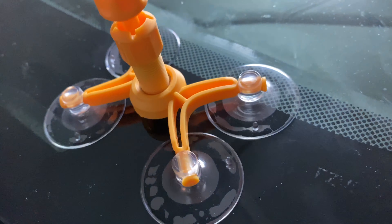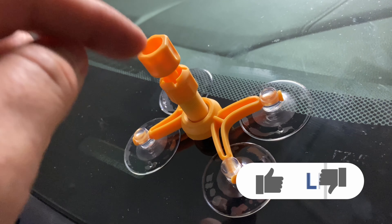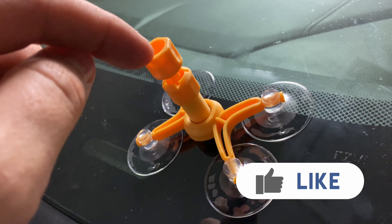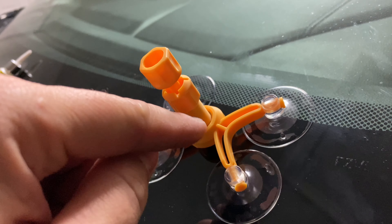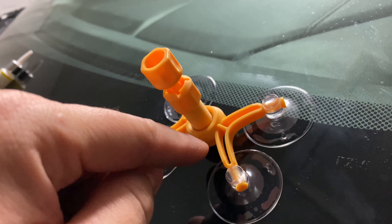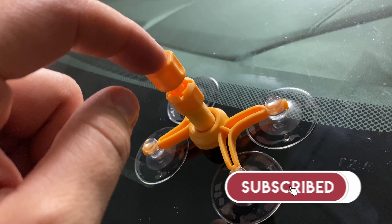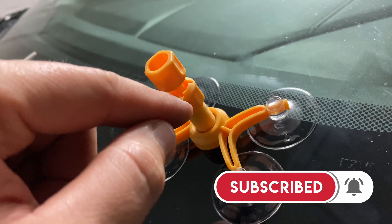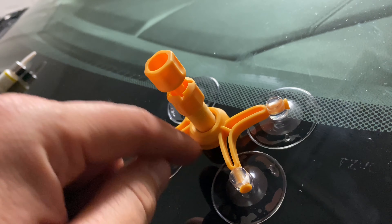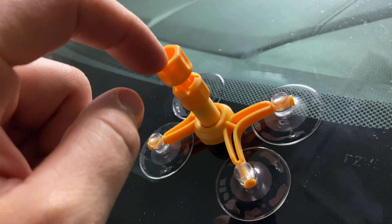The status on this one is that the crack looks like it's fading away, which is good news. What I did was unscrew and rescrew the device — the reason to do that is to let any air bubbles out. If air from the crack gets stuck in the chamber, unscrewing all the way and screwing it back in lets that air come out and then applies more pressure, allowing the resin to travel into the crack. I'm going to let this sit for another few minutes.